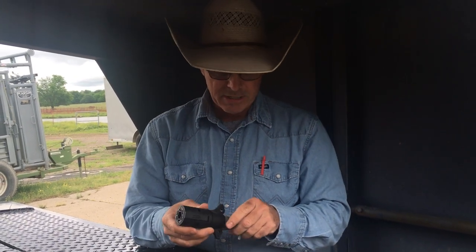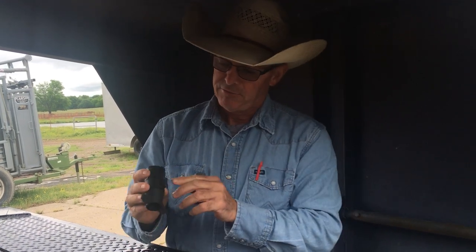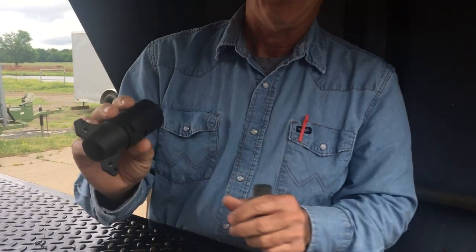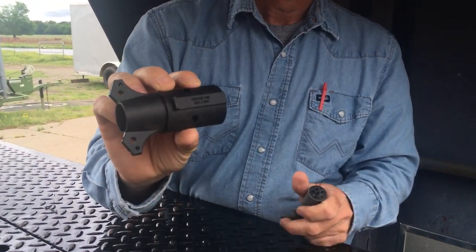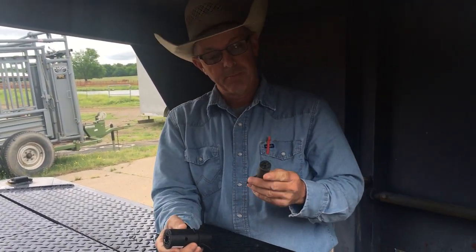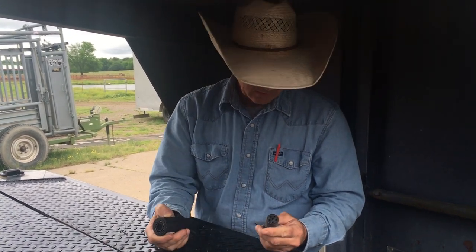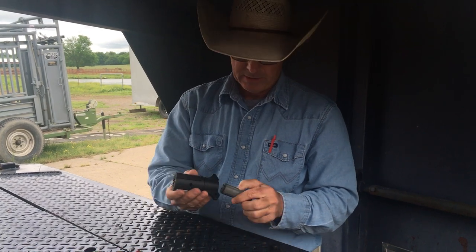The problem is there's a hot wire built into the seven-way plug that comes through this adapter. Look on the adapter — it should say 'center pin auxiliary.' That's the issue if your brakes are wired in the S position on your trailer.